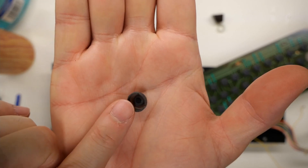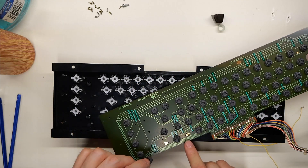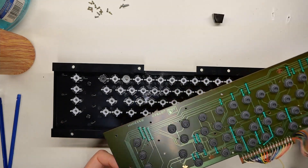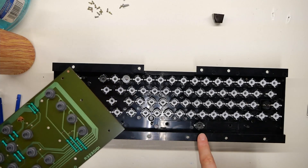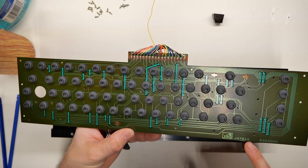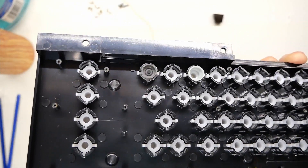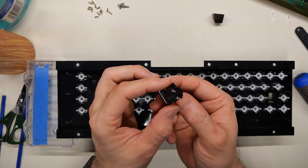The actual little contact is inside the little rubber dome. So whatever keyboard I borrowed this for, I stole the dome from this key right here, and the replacement rubber dome I have will provide the tactile feedback when you push the key, but it's not going to make the key actually work. I have to be very careful not to dislodge any of these. It has TKR as a brand name, J075A0, R3220101 — all written on the PCB. The sliders are round and they hold the rubber domes. The shift lock key comes out as well and that's round too.